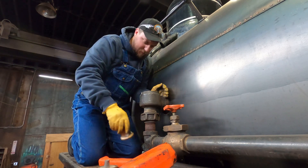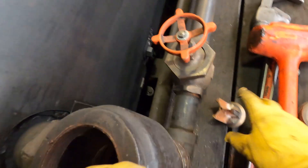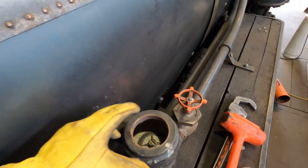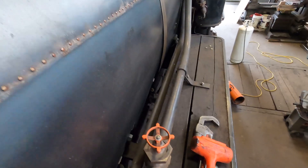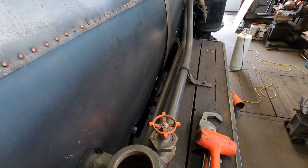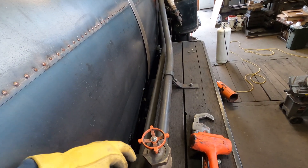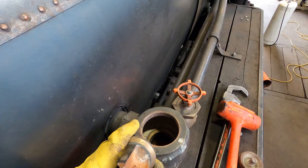It's in really good shape. So let me show you how this works. This right here is your valve — it's got this seat on it. When this valve goes down inside of here, the boiler pressure actually keeps the valve shut. The boiler pressure can't feed back into the injector. So when the injector gets turned on, it's actually putting the water in at a higher pressure than what's inside the boiler. The important part is that we have to make sure these surfaces are happy so that they seal correctly.